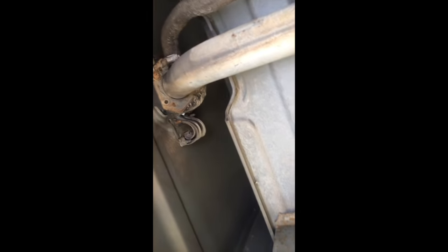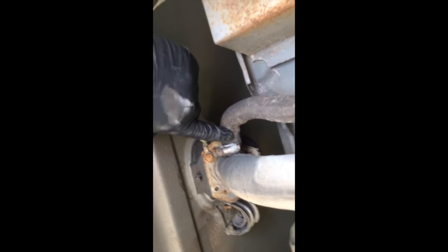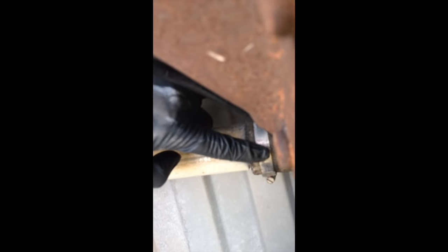What we're going to do is disconnect this vent hose here, disconnect this fuel filler hose here, and there's a couple of straps with bolts on the other side. We're going to take those down, lower this enough to disconnect the electrical on the fuel pump module and disconnect the fuel line. I'm going to pause it here and we'll proceed to the next few steps.